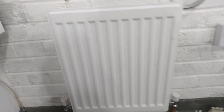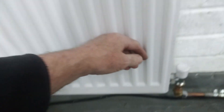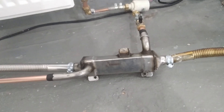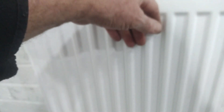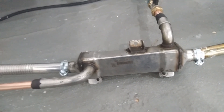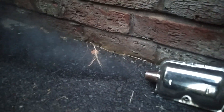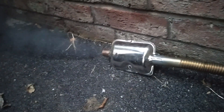I've just topped the radiator right up to the top and bled it through the nipple there, so the radiator is full of water and it's hot all the way through. Honestly, out of all the little experiments to get heat out of the exhaust, these heat exchangers are the way to go - that's the best results I've had yet. It's really warm and it's been on no time - it's what it's for, it's a heat exchanger and it's working. We've still got some steam condensation coming out the exhaust, and we're taking all the heat out of the front part of the exhaust.